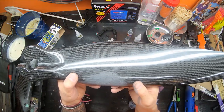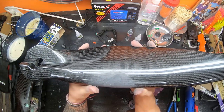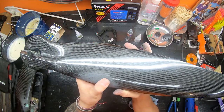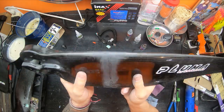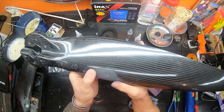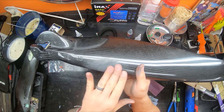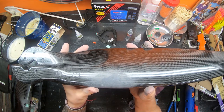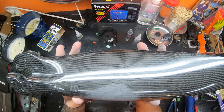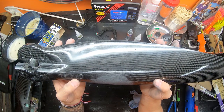I'm going to throw my extra prop on because this one needs to be balanced — there's a lot of Q-Bond in it. I'll put clear coat on the other prop until this one is balanced. To wrap up: if you have prop damage similar to this, Q-Bond is an awesome solution. Just make sure you clean up the surface, get rid of all the excess carbon fiber, so you can sand it smooth. I had a lot of success with Q-Bond rebuilding my Scout. There you have it — prop repaired! See you guys in the next one.